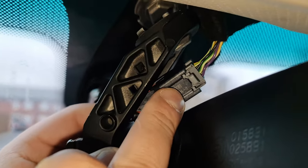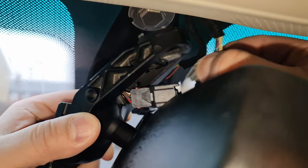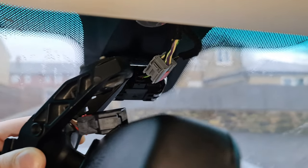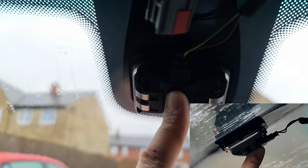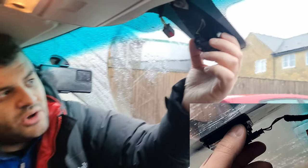There's a cable here — can you see this cable? It has a clip. What we need to do is remove this clip, hold it, and lift it up. The reason this is not working is it needs to be fully attached to the glass to see how severe the rain drops are. The more it's raining outside, it will act faster. If I hold it, you can see it stays for a little bit but then falls off again.